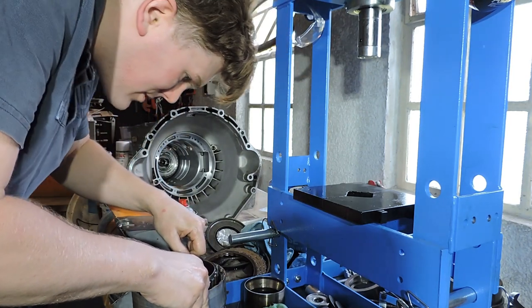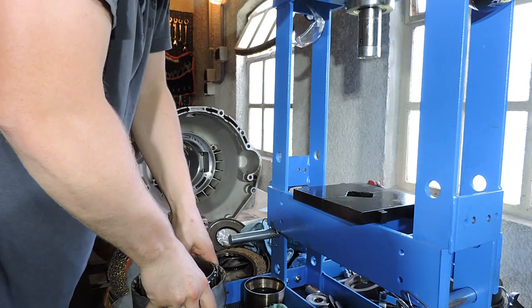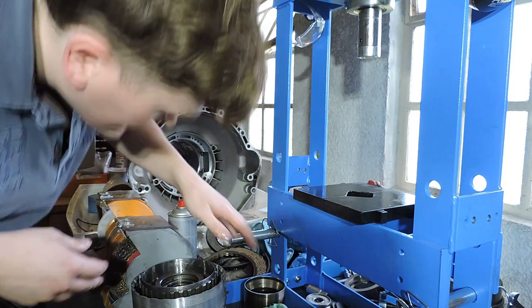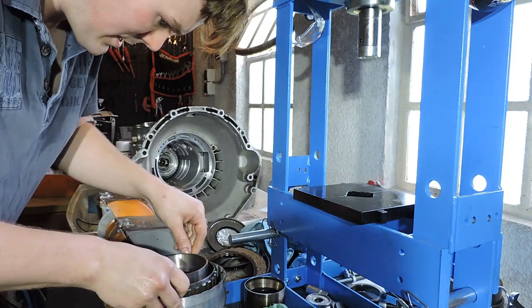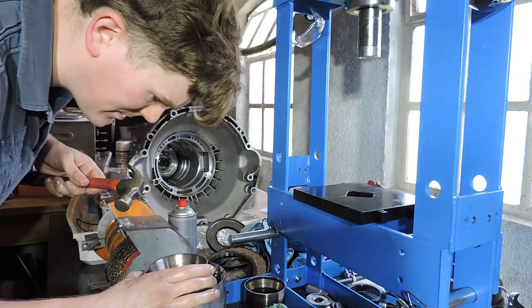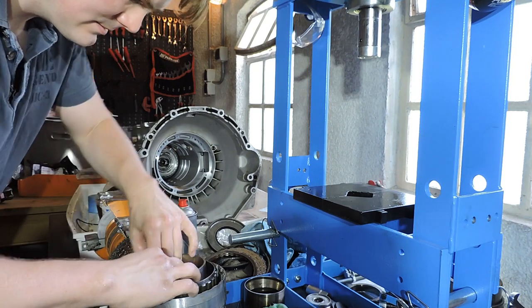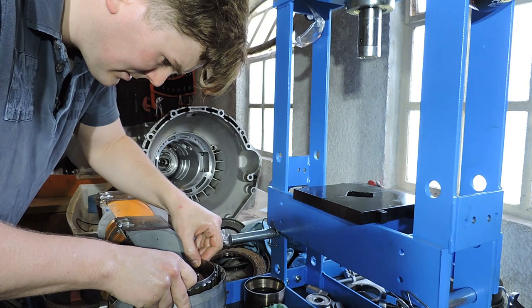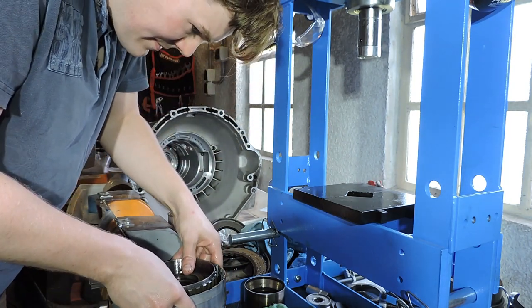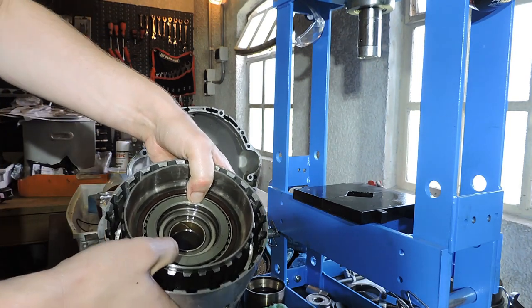I may actually need a rubber hammer for this. So let me get my hammer out. Never mind, no rubber hammer inside. See if I've got a piece that can assist me. I do. This old bearing race fits nicely, so now I can use a normal hammer. And holding that sprag bearing in the middle. Got a few millimeters of progress. That's it. But now we have the risk, if I release the drum, it's going to drop out again.